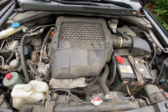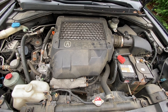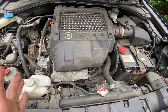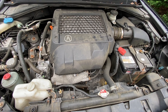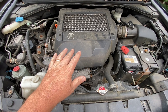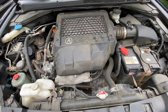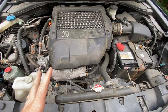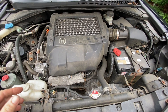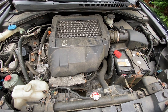Today's video I'm going to explain what a dead miss is and how you can find out if you have one, and the procedures for fixing it. This is an Acura as an example — it does have a dead miss. A dead miss is not a sporadic miss where the engine every now and then shakes, which could be ignition or fuel. A dead miss means the cylinder is dead — no compression, burnt valve, cam lobes not opening, no spark, no fuel in that particular cylinder.